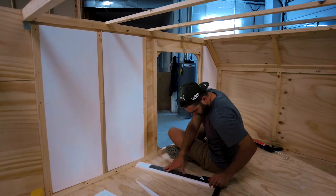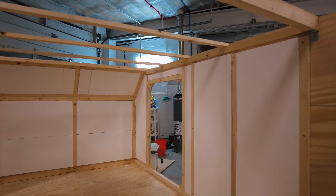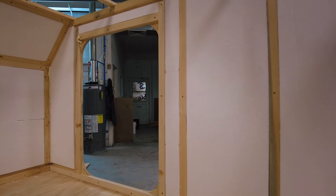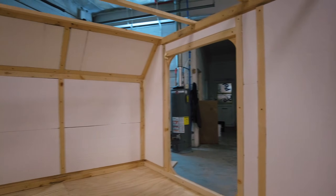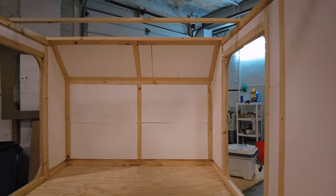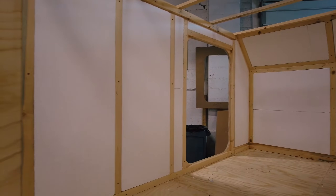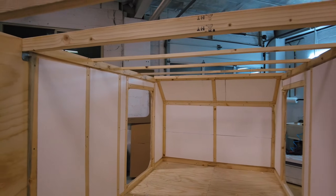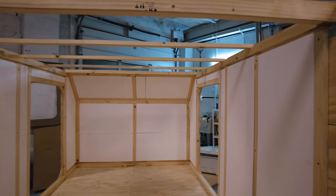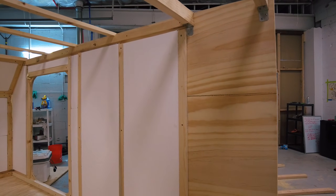I then went through and cut each piece of insulation to fit the spaces I had created. While the insulation was pre-cut, I still had to cut the height of them and cut them to fit all the smaller spaces like around the door. Here you can take a closer look at the finished product. You will notice some three-quarter inch gaps at certain places in the foam — this is intentional, as those spaces will be where my wiring is held. I plan on running my wires from my battery in a storage box on the tongue, through the front wall, and then back to each part of the camper. You can see all of the wiring in our next video.